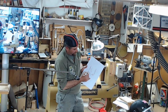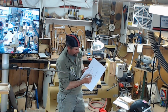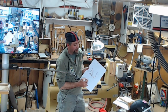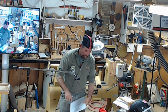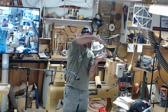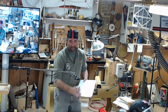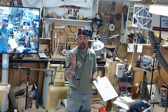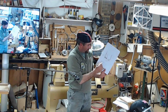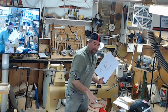Well, that's why you do it up a little bit instead of level, because when this starts to go and it's coming back, you still have this piece of wood here, because you still have that inch where this notch is going to come back and catch into there. But it's going to make that trunk jump. When it closes in that notch, that back piece is going to bounce. Sometimes you can use that. I've used that notch to actually bounce and jump over plants that are surrounded around the tree. And some of them I don't want to go that far. Well, I'll do the opposite notch, the Humboldt notch, where it slides into that and then slides off to where I keep it close.